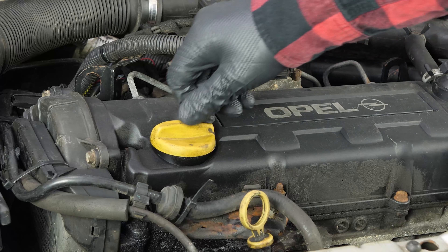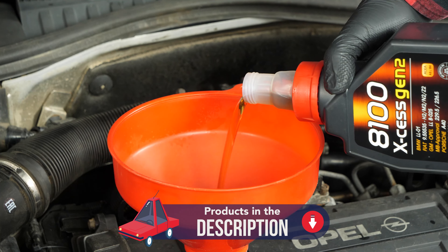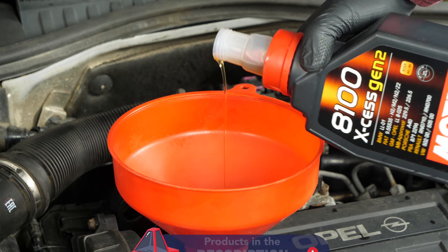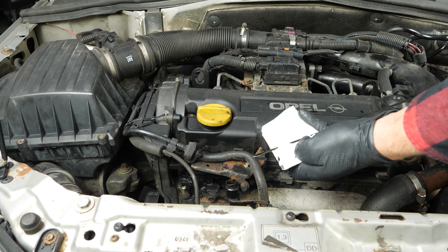This is considered to be perfect when it is in the middle of this part. However, be careful never to go over the maximum level — you risk breaking the engine. If you notice that the level is low, open the filling cap and add a little oil; we are just talking about a few centiliters, no more. After wiping down the gauge, put it back into the sheath to check the level again. Repeat the filling process until you reach the perfect level.